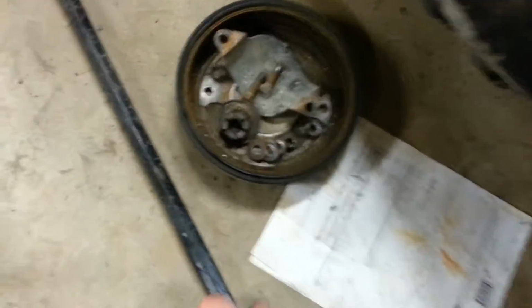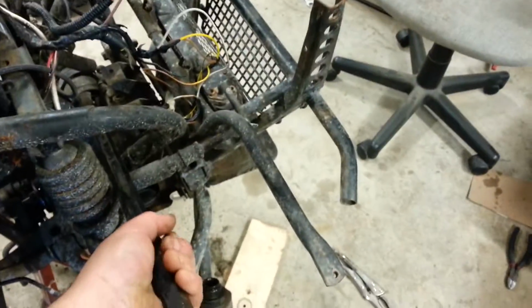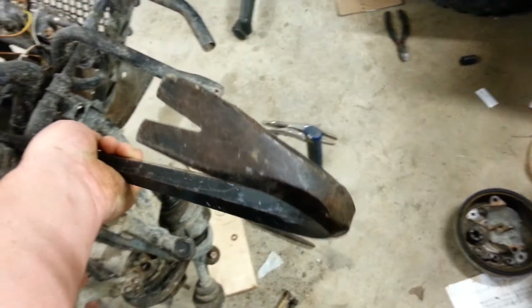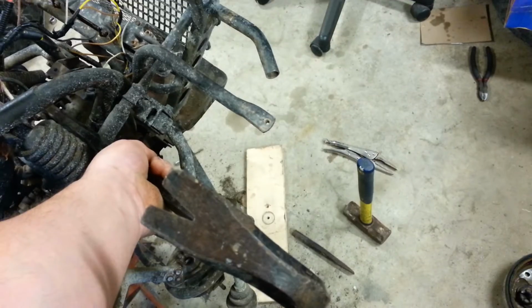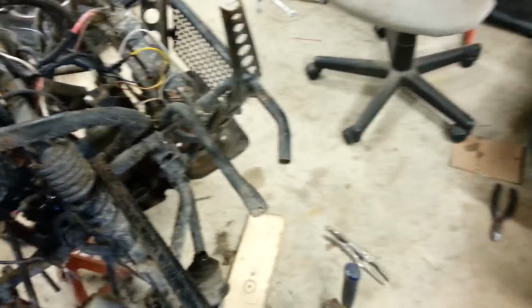I took the crowbar, using that end, I put it into the frame. I went down, I hooked it in where I could behind the large part of the CV axle, down there. And I came back here, I took that little maul and I wailed. I wailed on this. I said, it's broke anyway, whatever happens. Sure enough, gave it one or two good smacks, and boom, out it came. Now I couldn't put it back in because it's already over the snap ring.